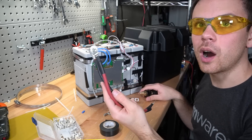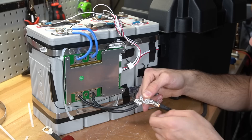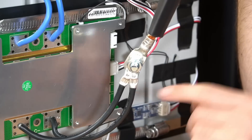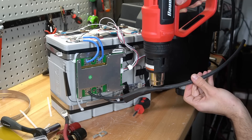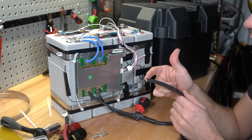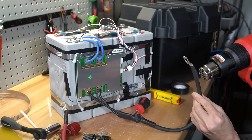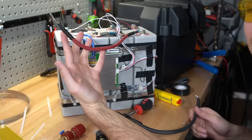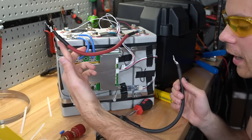We're going to make that connection with two wires. First, connect the two connectors to the main negative using a machine screw and a nut. After the wires are connected, slip some heat shrink over it. Now the negative cable is done - just add a terminal connector so we can connect it to the main negative terminal. Then add the positive cable to the main positive of the battery until we have a complete main positive and main negative.